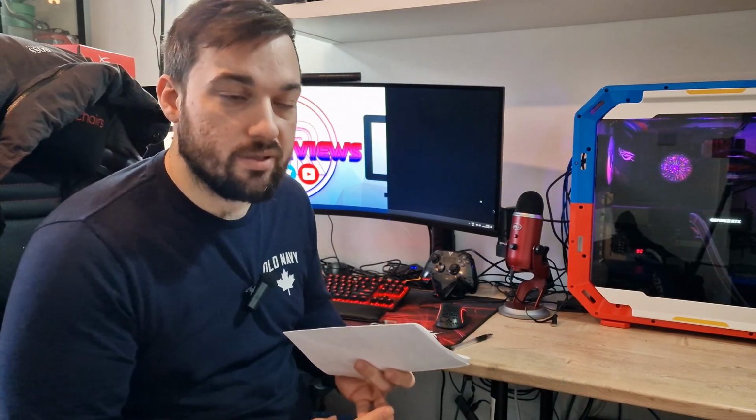Now obviously I could have done game testing and everything like that, but this is giving you an overall view, the worst case scenario of it being Cinebench. So for other applications, it's going to be obviously lower temperatures. So what I've done is I've tested it in Cinebench. I've tested it at 100% fans and 50% to give an idea of how they perform at different speeds.